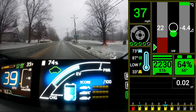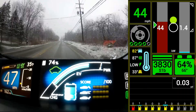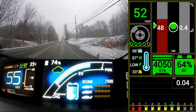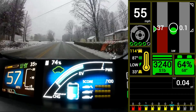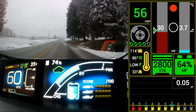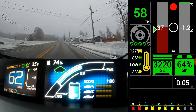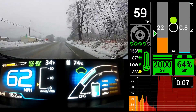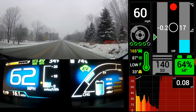Let the cruise control handle acceleration the way it wants. You can see it got up to about 4,000 RPMs on that hill — it's about a 100-foot hill over a 0.4-mile length. Also notice the app has a gold border around everything until the engine is warmed up. Once it gets to S3, which is 158 degrees, the engine will be off when you're stopped or if demand isn't high — like in EV mode going down a hill or coasting.